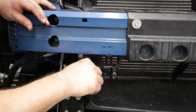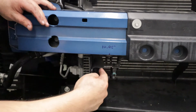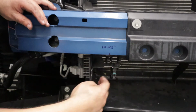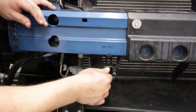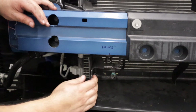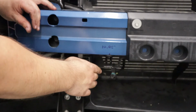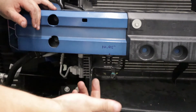And then we will need to clearance this duct just a little bit. You can see right here, what I've done is just basically cut a little notch out. It's probably about 1 inch wide and about 1 inch deep. I used a pair of side cutters. So all you need to do there is snip a little piece off, and then I was able to cut the sides and then bend the tab down, and it snapped off after a bit of light scoring on the back. Maybe use a razor blade or something like that. So do that on both sides. You'll have the clearance you need to install the splitter rods, and you'll have the clevis that you need to mount the splitter rods. So now I'm gonna go grab the splitter rod and show you how to assemble that really quick.